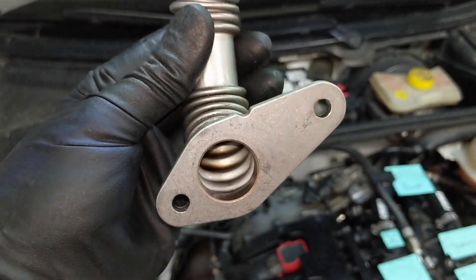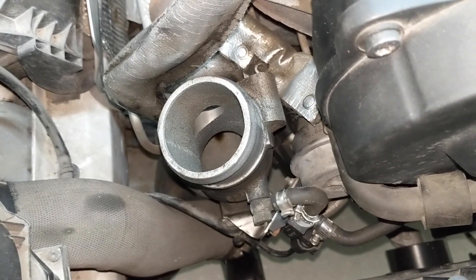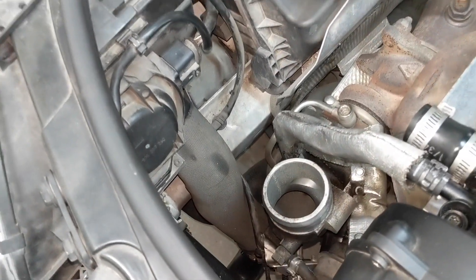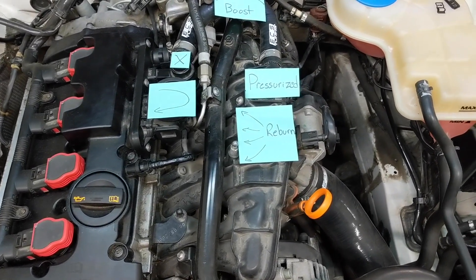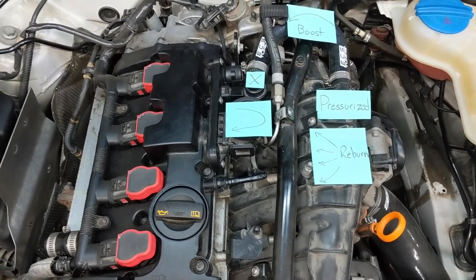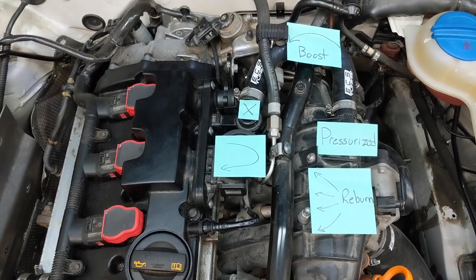Sadly this is the perfect time to illustrate why these cars get so much oil in the intake track. Look at the inside ribbing of the rear hose — covered in blow-by oil. And looking down into the turbo, you can see oil just sitting there in front of the compressor fins. It's also why you can take off the side-mount intercoolers in these cars and dump oil out of them, plus the charge pipes. It's also why we get so much oil and carbon buildup on the back of the intake valves. Overall the stock PCV system is actually quite successful in achieving reburn for emission standards, but ultimately it's just a massive sacrifice for the efficiency of the car. You can see why so many people modify to block some of the ports or run catch cans. Whatever you pursue, it's really important that you manage the crankcase gas somehow.